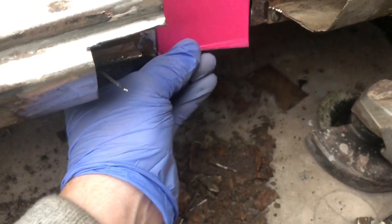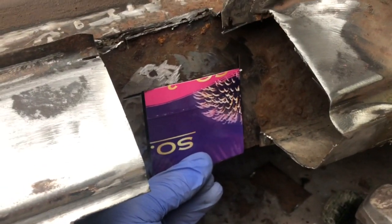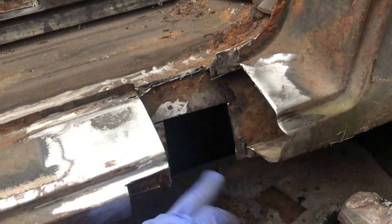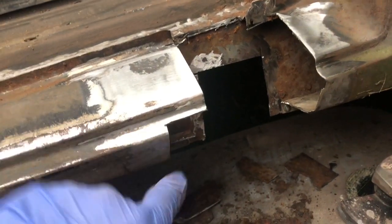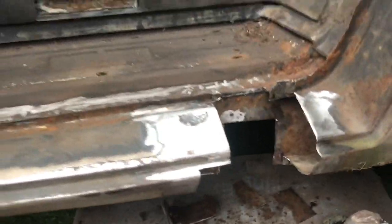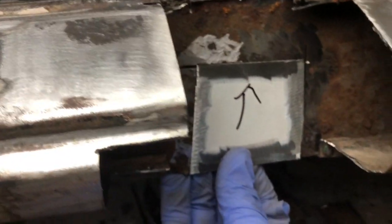Here's my first template, so I'll get the inner sill cut out in metal and get that welded in first. Then what I'm going to do is potentially work on this section here, just plating it for now, and then work my way along. I won't be able to do it in one piece, but hopefully I can get that bend on there — try and get this sweeping bend, do this section, probably do this little bit in one piece and another one there. I don't think I've got the skill level to do it all in one. I've cut out the first bit of metal from some scrap steel I had — that'll be welded in like that and then we'll start building the rest of it.